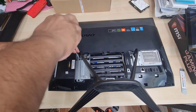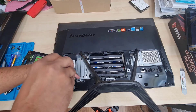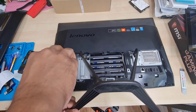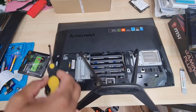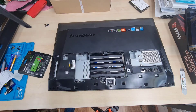One more thing: you have to be careful because this screen is very bulky due to its large size. Make sure the surface is clean when you put it upside down, otherwise you're going to find some scratches on the screen. Now we can pull the handle straight out, giving us more room.